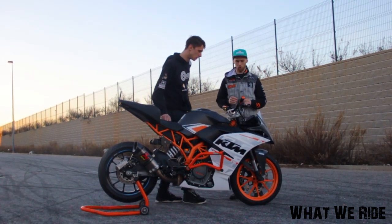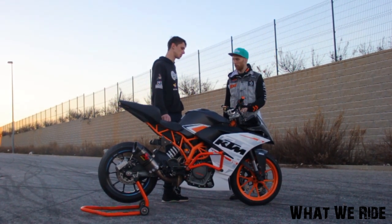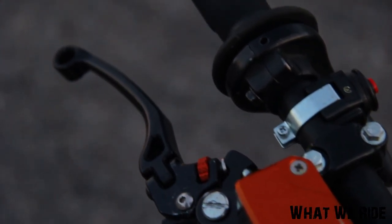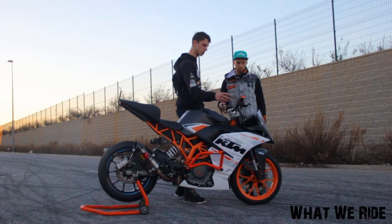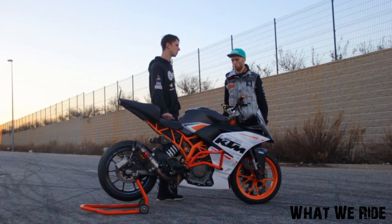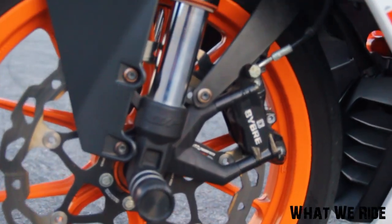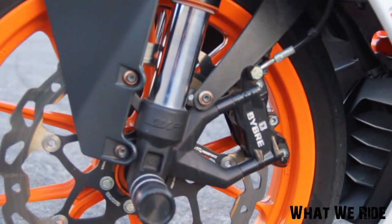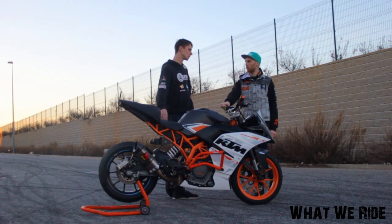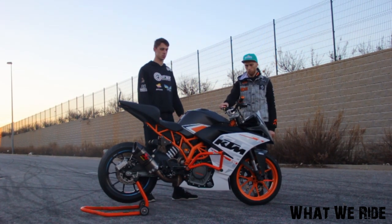It's also a Magura hydraulic clutch — you can find it on some stock KTM bikes. The front brake is a stock one, just an adjustable brake lever — nothing changed, it's more than enough for stoppies. The front disc is an oversized disc so it has more bite when you do stoppies. The stock one is around 230mm, quite small, and the oversized one is around 320mm — like on a Kawasaki — so this size is way better.